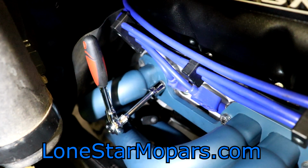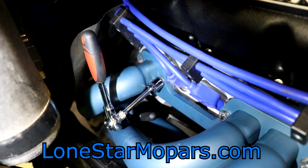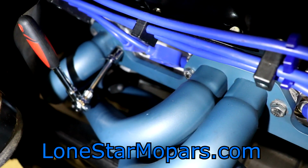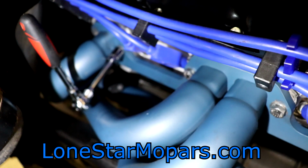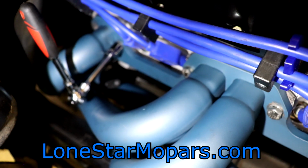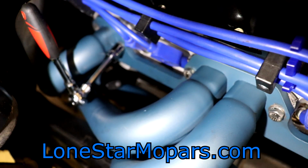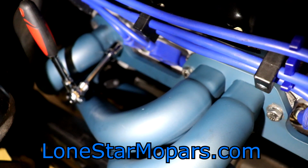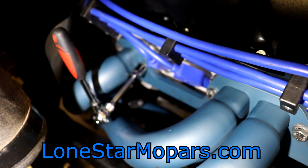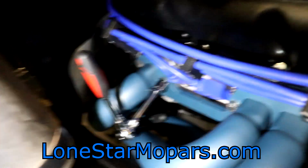But I know where the bolt is, I know where my magnetic pickup tool is, I don't know if I can get them out. So that's what I'm going to try to do. The gap in between the primary tubes at the bottom, you can't really get a screwdriver through it. All my plastic trim tools, which would protect the Cerakote finish of the headers, are way too fat. So I got a scraper up in there, but it's not strong enough to push the bolt out that's wedged in. So I'm just going to have to piddle around down there until it comes out. But we shall see. It's the last bolt, and it should be pretty easy to tighten in. It doesn't have as much obstruction as this one does. So main thing is you cut your hand all the time on that firewall insulation. So I'm going to go try to get the bolt out, and I'll let you know if I succeed.